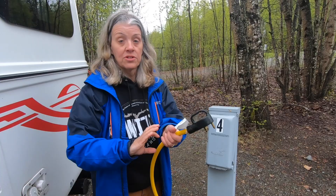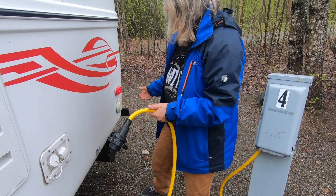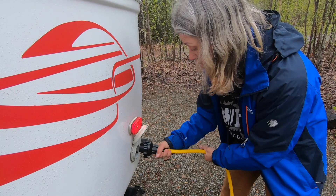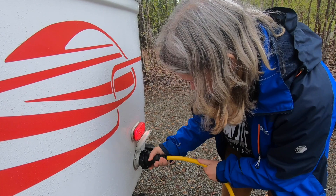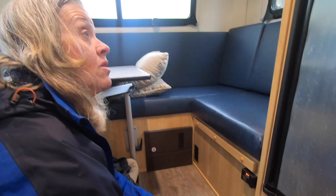If you have an EMS on board, go ahead and plug it in, then let's go inside and check the EMS. I've turned the EMS to normal use — we had it in bypass mode when we were using our generator. I'm getting an E0, which means it is normal. We have our little code reference for the EMS codes up there, so it's all good.